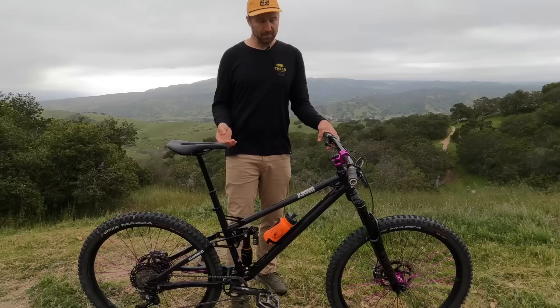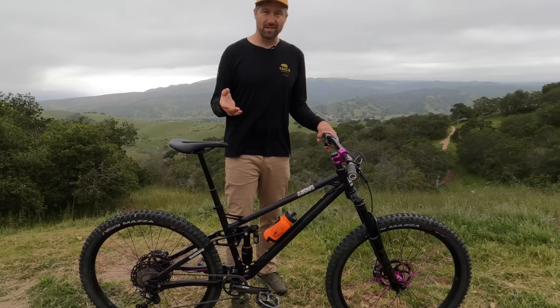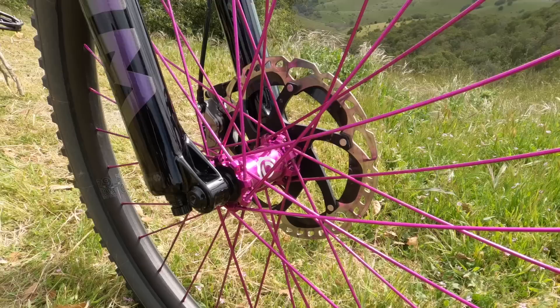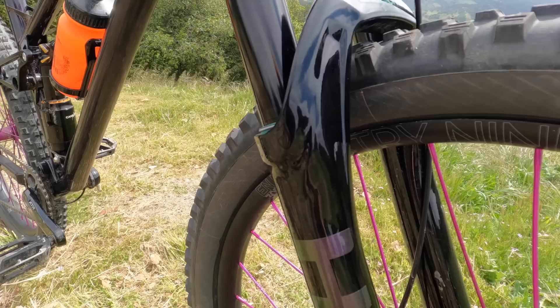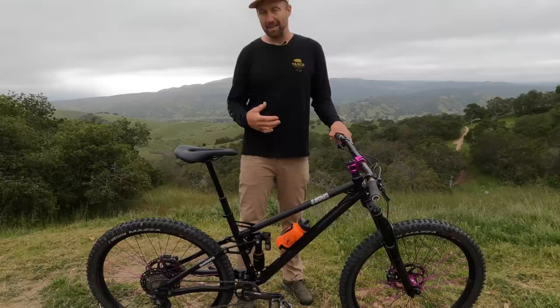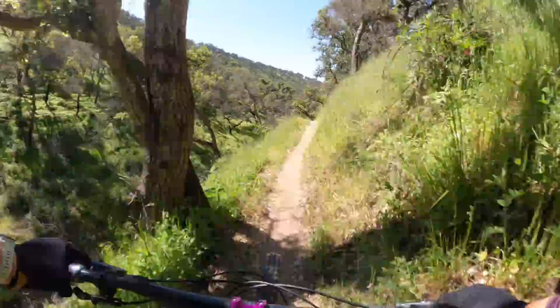Let me talk about my components and how I set it up, and then we'll answer some of the common questions I've seen on social media about this bike. I'm running Shimano XTR brakes and drivetrain. The gearing is a 32 tooth chainring in the front combined with an 11-51 cassette in the rear. Another longtime sponsor of mine is Industry 9 — Enduro 305s on this bike. Those have Vittoria Mazza tires. I use a 2.6 in the front and a 2.4 in the rear. For the cockpit, I'm using Shimano Pro Tharsis handlebars — a 30 millimeter rise carbon handlebar — and for the stem, I'm using a 40 millimeter Industry 9.